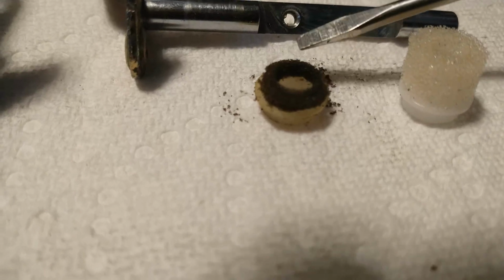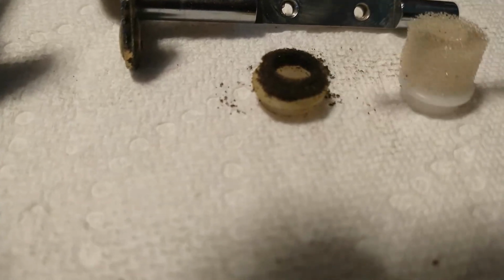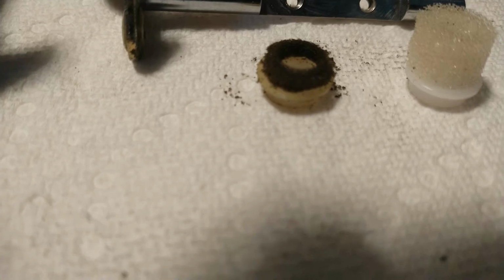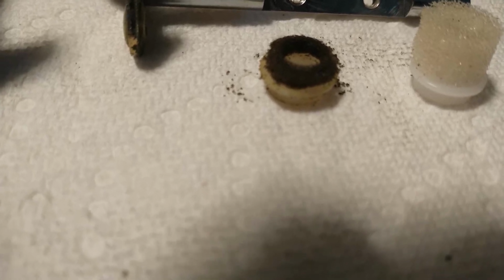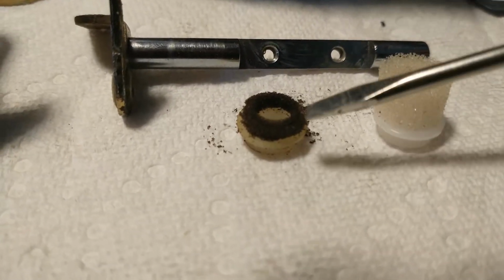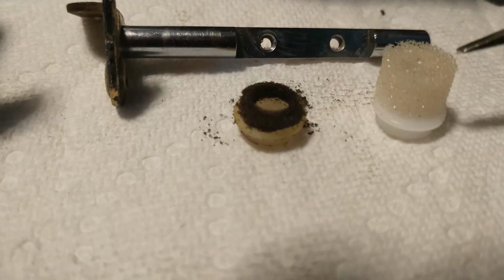I hit a big bump the other day testing this engine out, and it got all wonky, and I had to pull the choke on to get it to stay running. I'm like, well, geez, that's weird. So anyway, I had a rebuild kit all ready for it. I'm going to do this anyway. And as soon as I started taking this apart, I looked at my parts in my bin and said, oh, there's a new gasket for that throttle shaft. And you can see this one is toast. You see how much thicker this one is. So we had an air leak